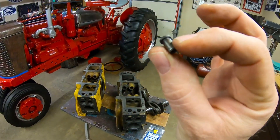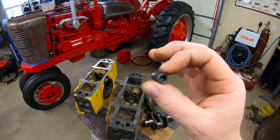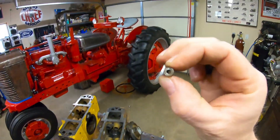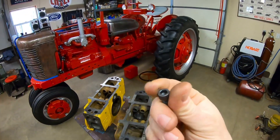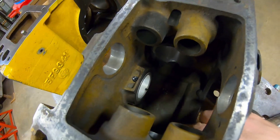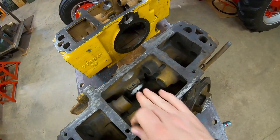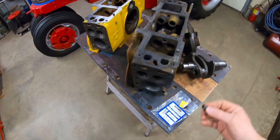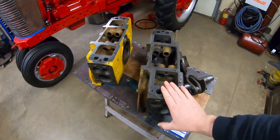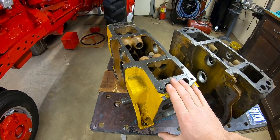Let's get to what we actually did. Try build veterans will undoubtedly remember that in that series I replaced the original Cat-designed straight-shanked bearing retention friction-fit dowel with an updated threaded version — 5/16 by 18 thread pitch allen head screws modified with an oil hole down the center, just like the original dowel. I also had to turn the head down a bit so that once I drilled and threaded the block into the aluminum bearing, these would go down with loctite and provide a near bulletproof front main thrust bearing retention setup, eliminating the eventual excessive end play that crankshafts accumulated after the dowels worked their way out.